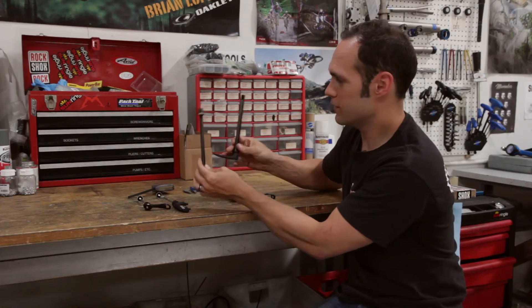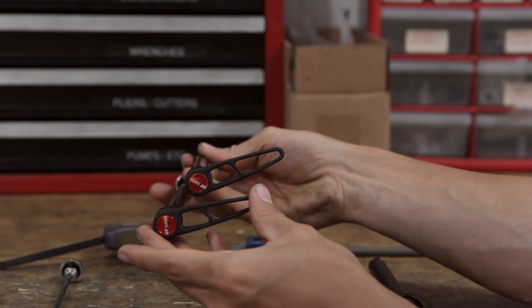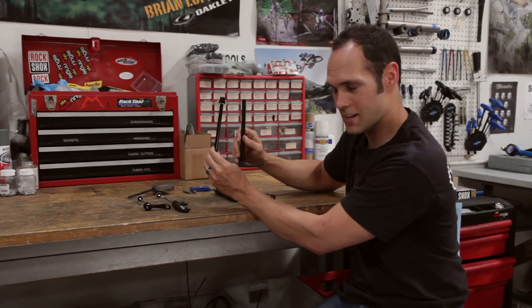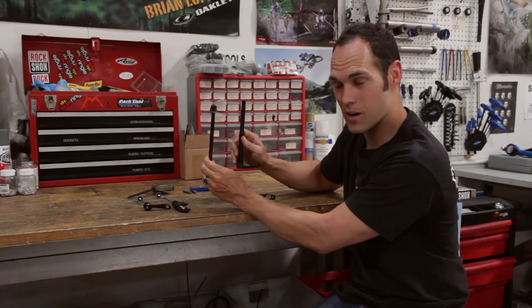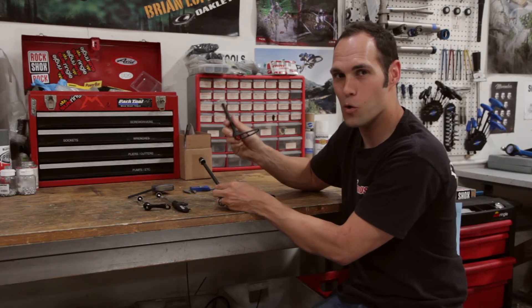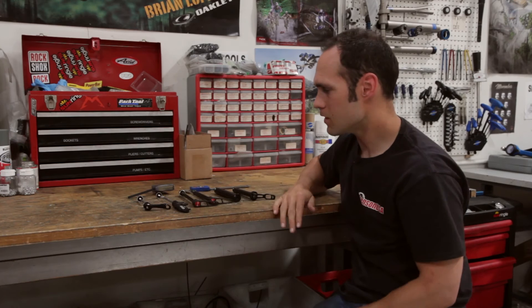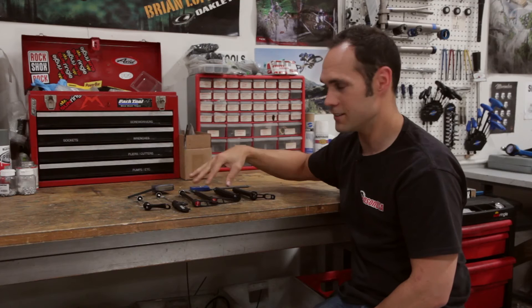This is important because you can have two skewers that look very similar to each other — the exact same logos, both threaded, slightly different looking — but this is a 12mm and this is a 10mm. Both are rear axles, but one works in your standard dropouts (the 10mm), and the other requires pre-drilled or through-bolt style holes that it slides into and tightens into place. So you really want to make sure you get those measured and figure out the difference.